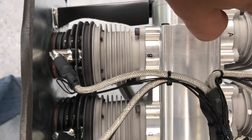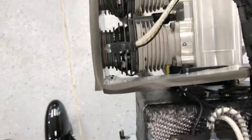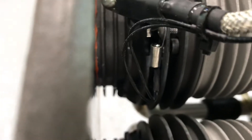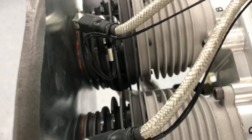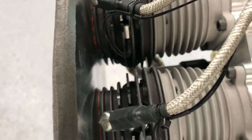On the airplane I've marked the cylinders A, B, C, and D so you know what's plugged into what. A couple of important things about the sensors: you can see the sensor mounted here with a 6-32 button head screw. The barrel itself is actually the sensor, and they provide some lubrication to help transfer heat. You need to push the barrel down into the fin like shown. From my experience in motorsports, mount these as close to behind the spark plug as you can — that gives you the best sensor reading.